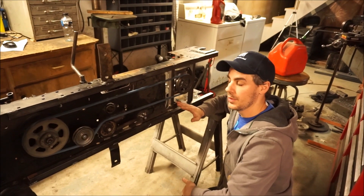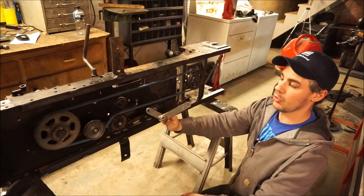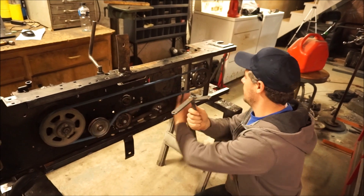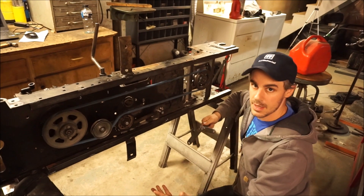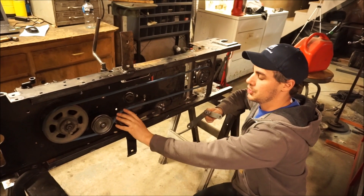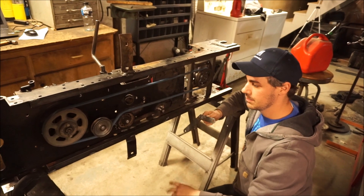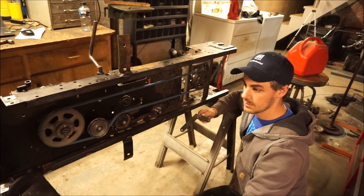So I'll show you what we've got going on here. This is a setup I made — I made four of these, three for the mowers I'm building and one extra. Pretty much based off what I made on my old SP years ago. Those pulleys are from that too: five-inch in the back, six-and-a-half-inch in the front. I'm going to use that as my basis for gearing. These are stock size, three-and-a-half-inch pulleys — both the V-groove and your flat — stock on Craftsmans. This is a Craftsman frame, so I'm using as many parts as I can off the mowers I use to build these.